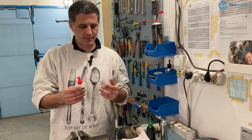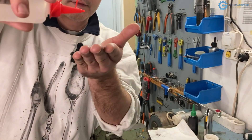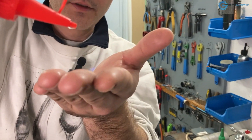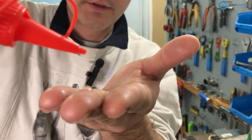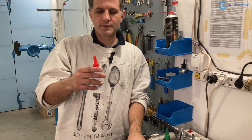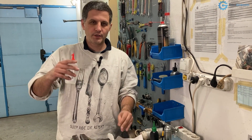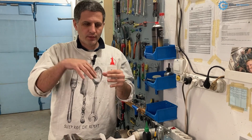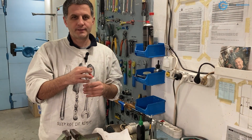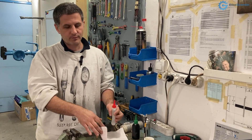Lower viscosity means they are very easy to drip. I'll try to show this one now — this is a very low viscosity oil and it's almost like water. So the lower the viscosity, generally speaking, the less dirt it attracts, the more easily it flows between all the parts you wish to lubricate, but also it more easily flows out and gets flushed out by rain.